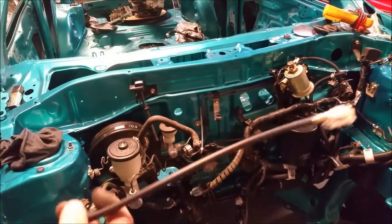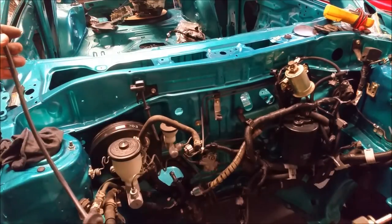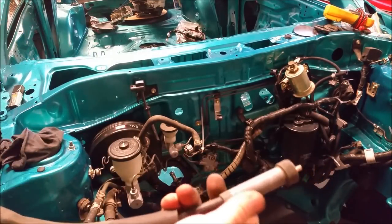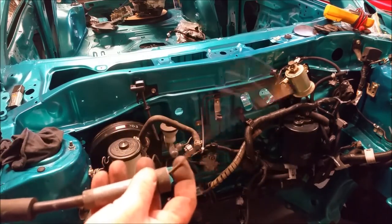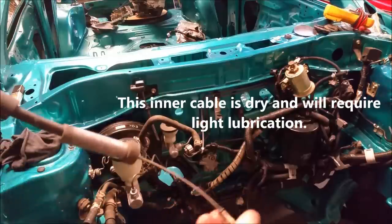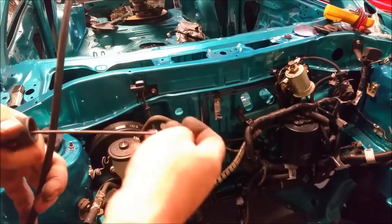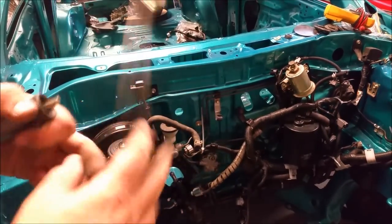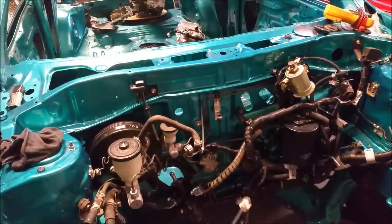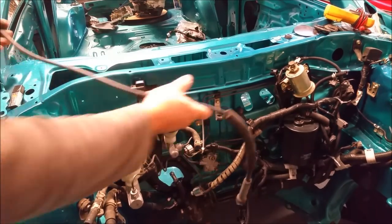Another component we can put on is the speedometer cable. It's only fairly short, and it's got a nut on the end which screws onto the gearbox on the engine. Inside there's a flexible steel drive wire that the gearbox rotates, and of course that goes on to connect to the back of the speedometer and give you a reading in kilometres an hour. Now, most modern cars use what's called a speedo transducer, so it's done electronically. But these oldies, we use a cable. Motorcycles still use cables, a lot of vehicles do.